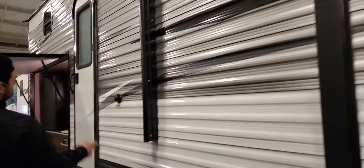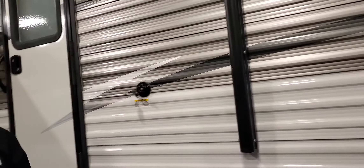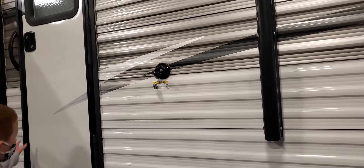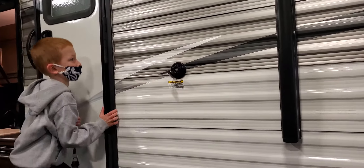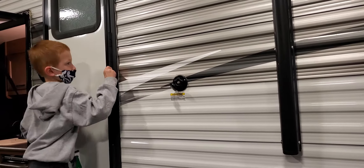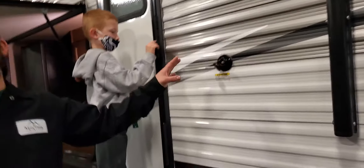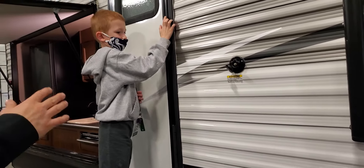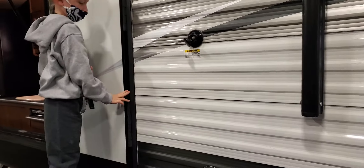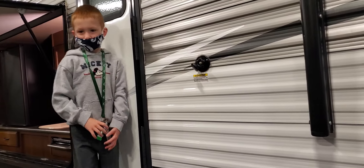Here is your black tank flush. This is where you flush your black tank if you ever have a non-true reading on the monitor panel. Hook up your hose and let it run for about 30 seconds, then turn it off and go inside to check your monitor panel. The reason I say turn it off is because this will fill the 40-gallon tank up within about eight minutes if you leave it running.